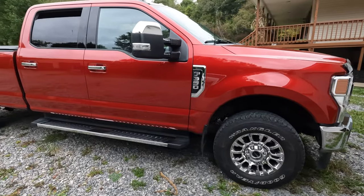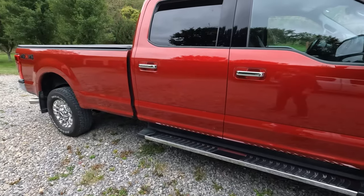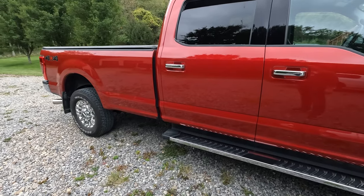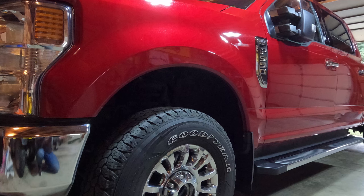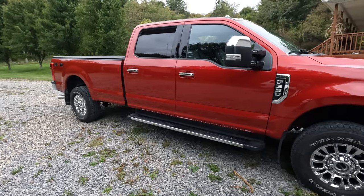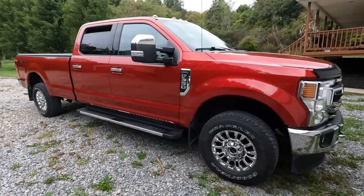An aluminum truck should never rust, but we all know that aluminum does corrode. My question to the guy that does the oil undercoating was: on these trucks, have you been shooting the oil down into the door frames, the rocker panels, and the tailgate? He said yes, absolutely - even on these aluminum trucks it's a good idea. It just keeps the moisture out and keeps the salt from corroding those body parts.